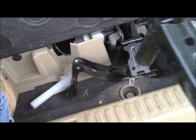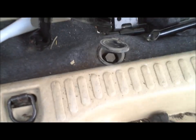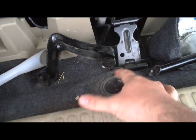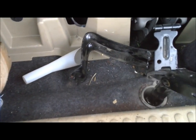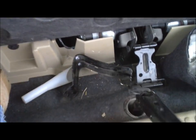The process isn't all that difficult — it's just a matter of keeping the steps in the right order. First things first, let's drop the spare tire. If you have a newer car, you probably have a setup where the tire is mounted underneath the trunk. Take the tire iron tool — it's a collapsible tool that comes factory from the car. You'll find a reservoir with a cap on it. Release the cap, drop the tool in, and start spinning. It might take 50 turns or so, but she'll drop eventually and you'll feel that tension come off the cable.